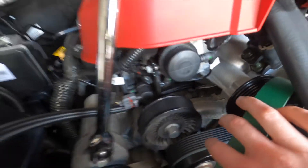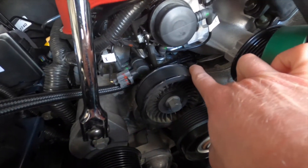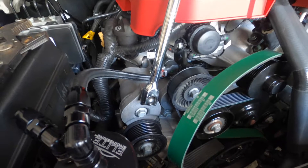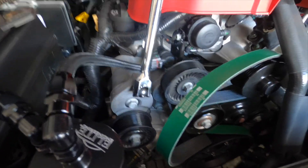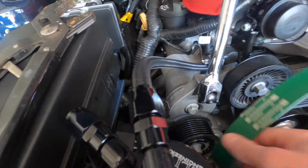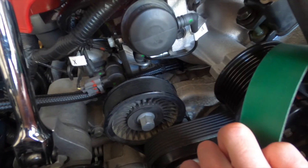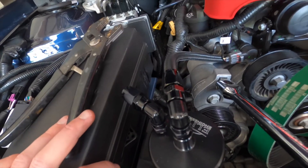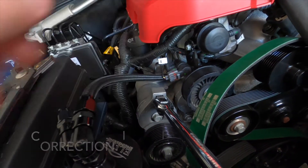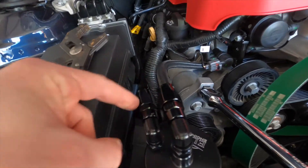In the process of putting the clamp onto the hose there, I had to remove the belt in order to get the pliers in there to squeeze the clamp to fit it over the port. To do that, I just attached my breaker bar to the tensioner, gave it a pull to the left — there's an arrow on there saying to rotate it that way. Once you do that, I pulled the belt off the idler pulley and was able to get my pliers in to get the clamp over the port. Now that the inlet port on the can is hooked up, we're going to go ahead and do the outlet port on the can, attaching the hose to the outlet port on the engine and lining it up to the port to cut it.